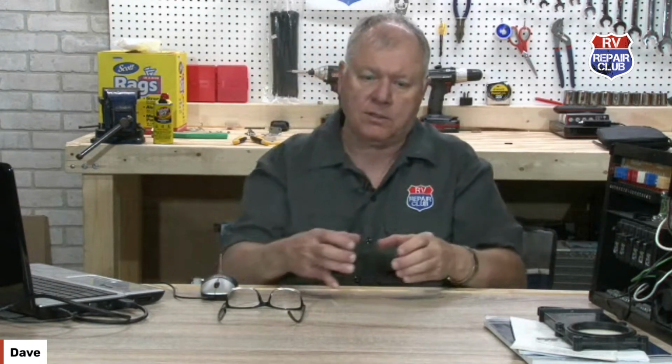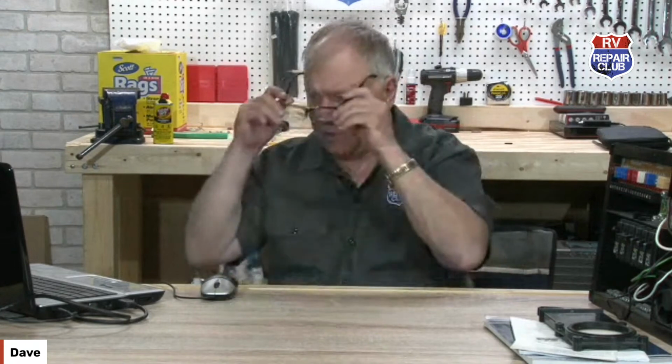You'll pull the front end off it, you'll pull the back end off of it. So there are specific points on those rigs that are designed to take the stress of being jacked up or towed. Usually, and I agree, you don't want to use the axle itself to jack that up, because you could bend the axle depending on the weight of it. Now, some of the manufacturers have reinforced the actual brackets and the knuckles for those axles, and they recommend placing the jack there. But your owner's manual should have the exact spot on that vehicle where you should be able to use the jack.